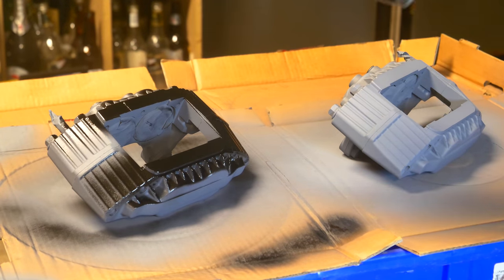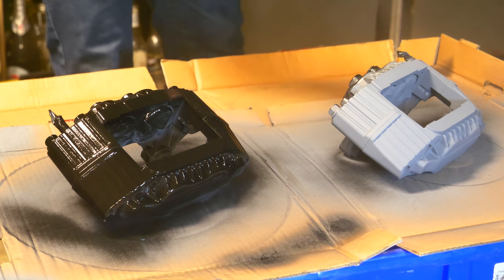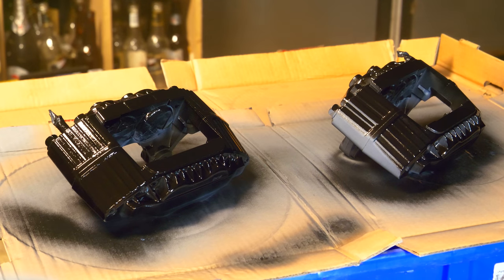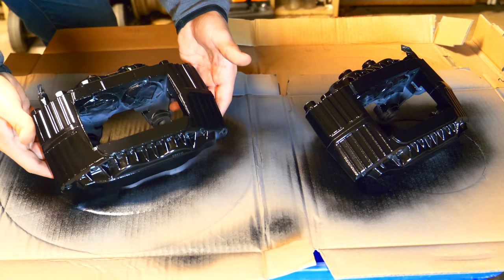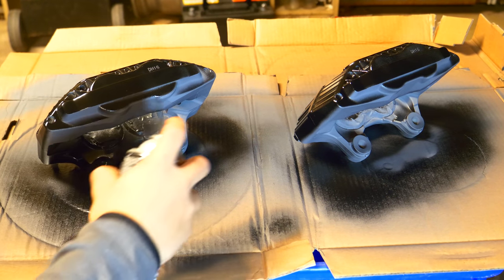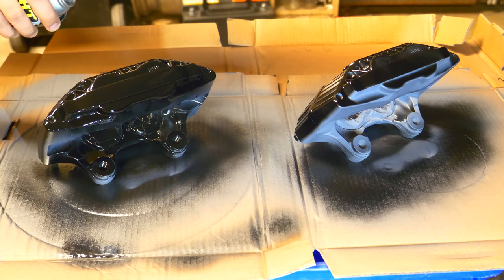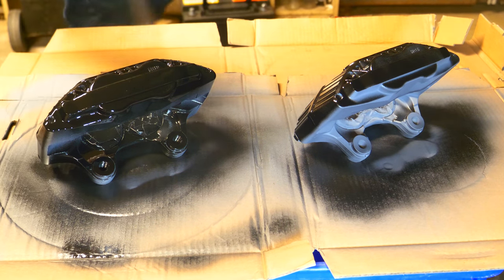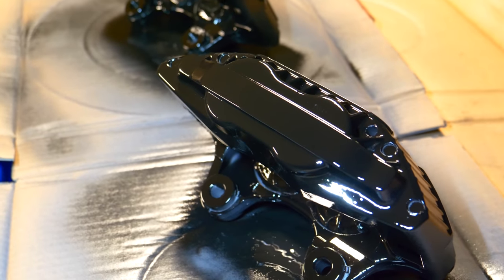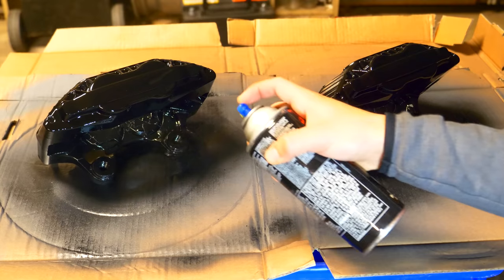Painting up our base coat is going to be quite simple. With our calipers facing down, I'm going to try to get the backside of the caliper and all the hard to reach areas first, getting the backside completely coated in black paint. Once we're done with the backside, let it dry for a couple minutes, then turn the caliper back and get the face covered in black paint as well. Getting the front to look good is more important than the rear, so take your time and do multiple coats. Since the primer is gray, it will be quite evident where you do not have paint. If you have any gray areas, make sure you hit them with some paint. Once the first coat is done, come back and hit it with a second coat, and then you're done with the base.